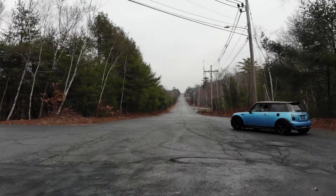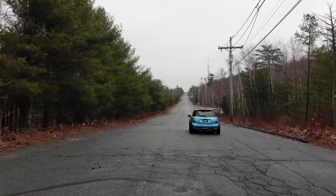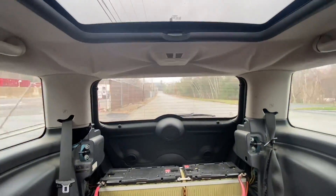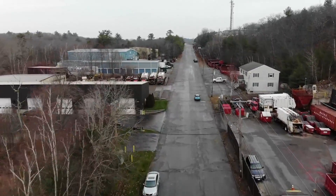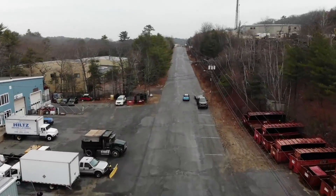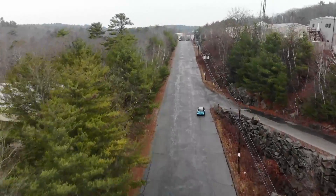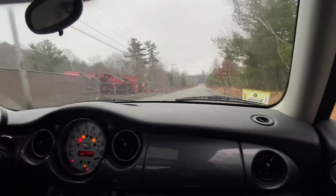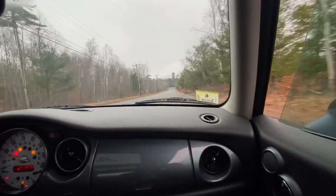Steven and I got a little rowdy, unfortunately, and after the bystander incident we got some pretty good metrics out of the car before heading home. We drove back and forth on the strip at slow speed until the battery died, giving us about 41 miles of range. We also tested the top speed, which was 101 mph on a private course, and a 0-60 time of 5.8 seconds. We achieved these specs by changing out some controller settings and putting the batteries in series to get extra power out of the motor.